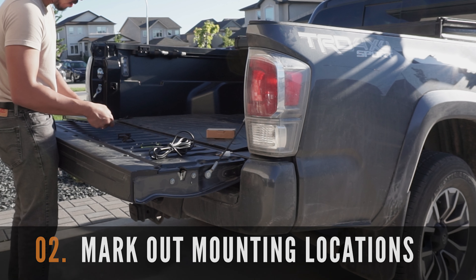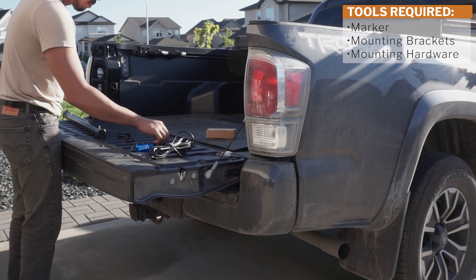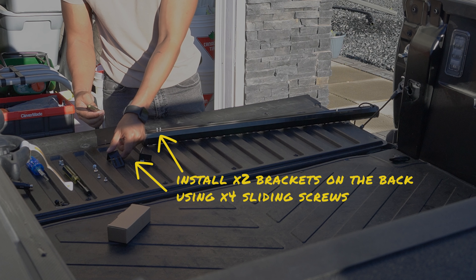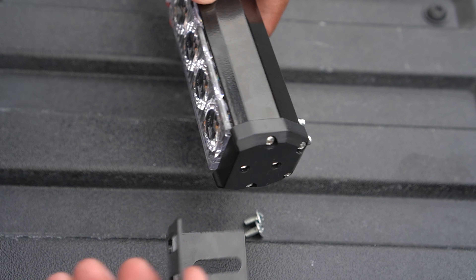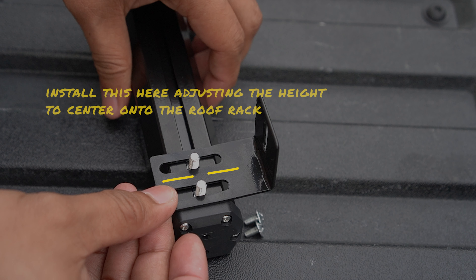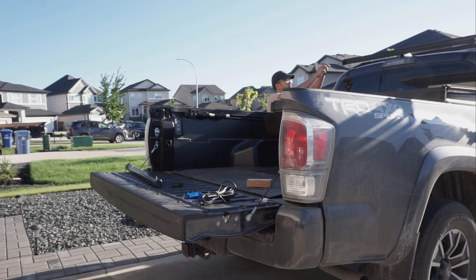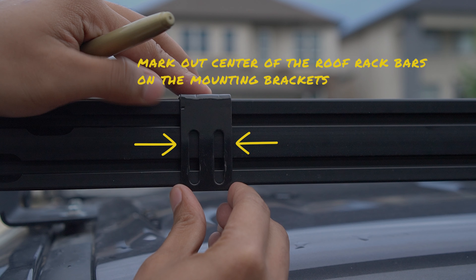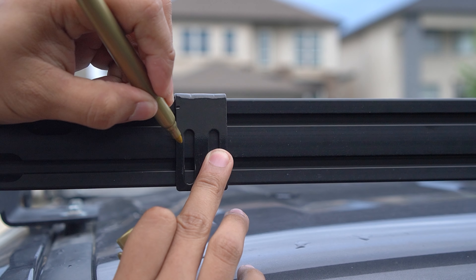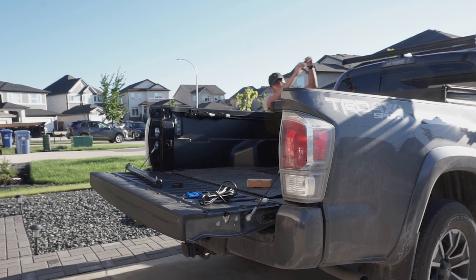After prepping the light bar, let's now start this install by first installing the mounting brackets on the back of the light bar. Grab one of the L brackets you removed previously and install it in the back using the two sliding screws. We're going to need to adjust this bracket up and down to center it to the crossbars of your roof rack. Grab your marker and head over to your roof rack, then place the L bracket on your roof rack and mark the center line of the crossbars on the L bracket. This will make sure that the 36-inch light bar is vertically centered on the crossbars when we install this later.